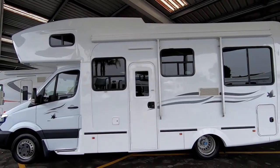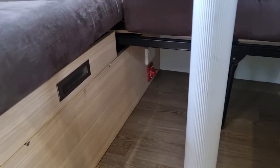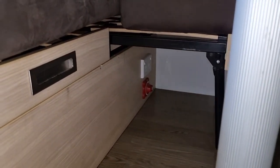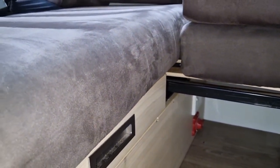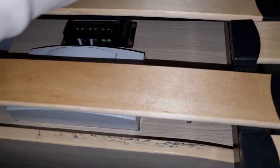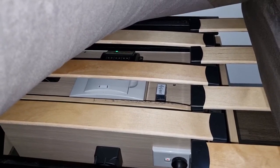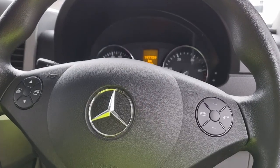Now we're in a six berth Horizon. Coming down here at the bottom, that isolator switch is just over there, but notice there are no circuit breakers visible because the circuit breakers are located under the seat. Once you lift up the squab and come underneath, that's where you find the circuit breaker, along with the solar charge controller — just located underneath there in case anyone gets stuck.